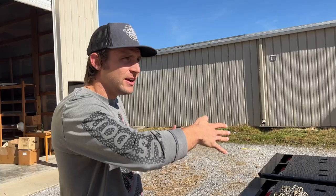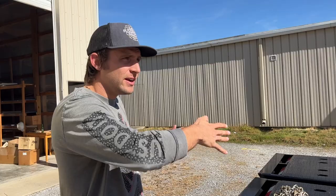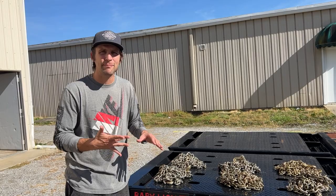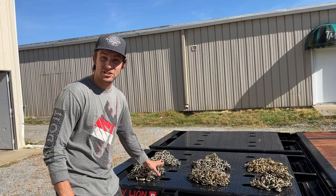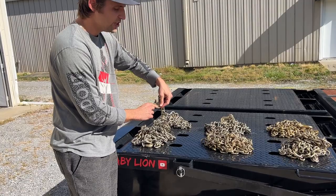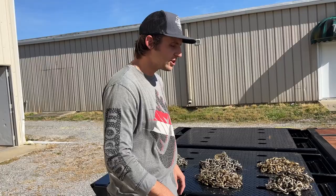We're just going to start from the back of the trailer and go to the front. First and foremost, you're going to want chains. If you are going to be hauling bobcats, tractors, any type of heavy equipment — I've hauled garbage compactors — chains have been working best for me. I have six chains and they are G70. This is what you need for hauling anything in the hot shot industry. Make sure they're G70. Those will be linked in the description.